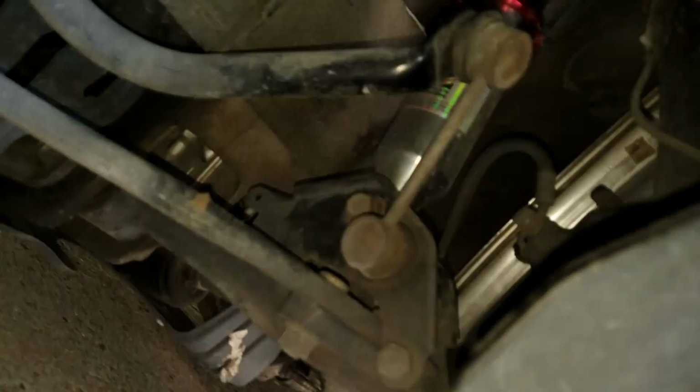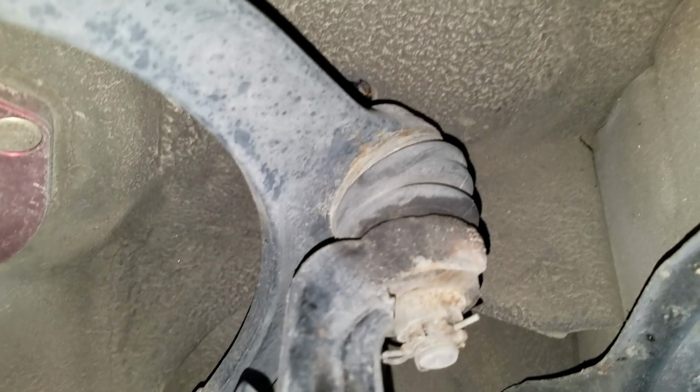So my car keeps making this noise when I go over bumps since I've lowered it a lot. And I knew it sounded like some metal on metal contact because I've had that before. And here's my issue. You can see that. The upper control arm is hitting the bottom of the strut tower right there. So yeah, I'll have to figure something out for that.